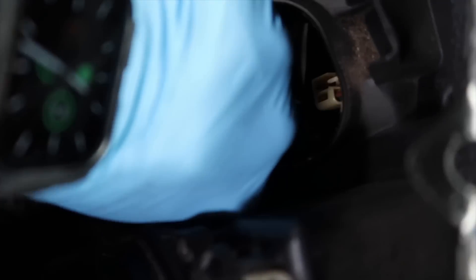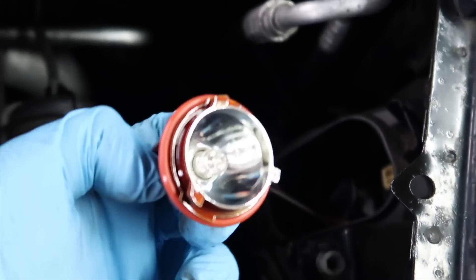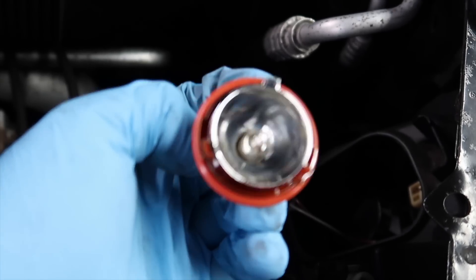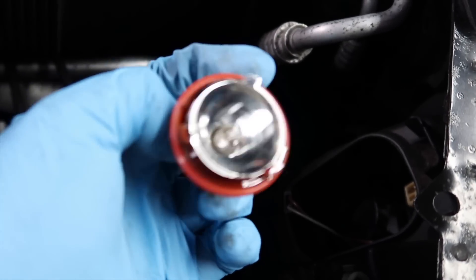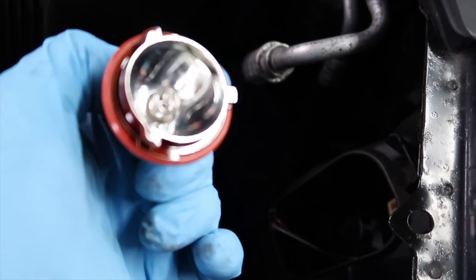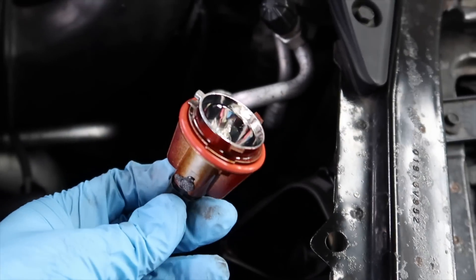This is the plug — we're just going to disconnect it right here, then turn the bulb out and unplug it. As you'll see, it's got a 501 bulb inside. This is common on the E39 as well — you'll find this in them, but only on the ones with the halo rings. If it doesn't have halo rings, you will not have these bulbs. If you've got a pre-2001 up to 2000 or up to 2003, you will not have these unless you've got a special edition model.